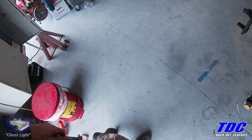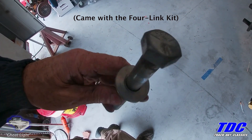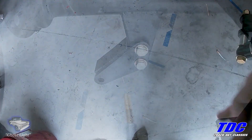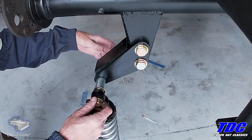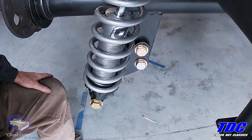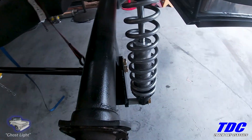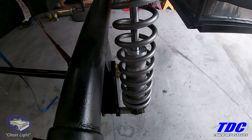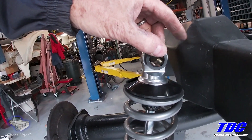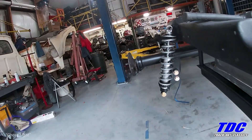So let me ask you — if you were going to sit your truck on one bolt, would you want to use grade 5 or something stronger? Yeah, me too. So we'll go with grade 8. This gives me the spacing I think I'm going to need. I'm just going to bring this out a little bit for clearance, and I'll make a bracket right about here. This needs some square tube, but I think that's probably the best place for that shock.